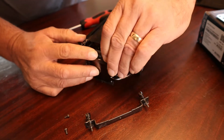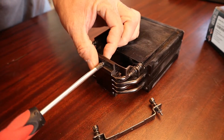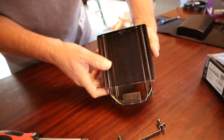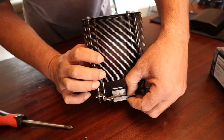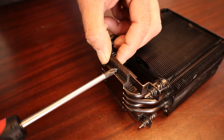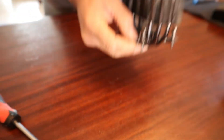Just like that, I'm going to hold that with my thumb, get my little screw here. It helps if you have a magnetic screwdriver. I'm going to go ahead and tighten that up — just like so, nice and snug. I don't want to strip the screw. Turn it over, and the same thing — there's that notch. Again, we're going on top of this channel on the heatsink. Using my thumb to hold it, nice and snug. So the brackets for the heatsink are prepped.